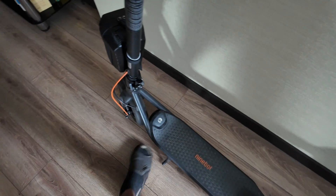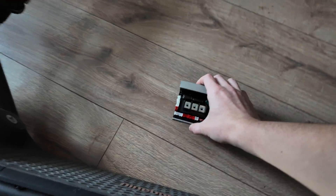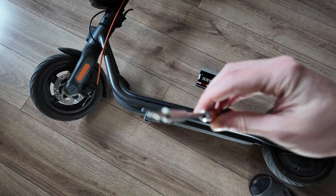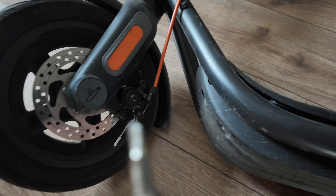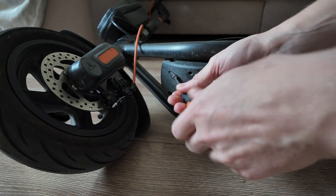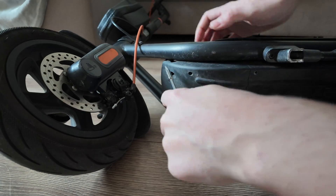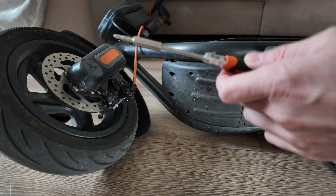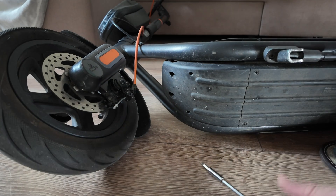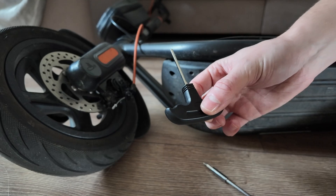Let's make it 32. First, what you need to do is disable your scooter and then put it on one side. You put it on the side, take the controller nearby. What you need to have is a screwdriver - just a regular Philip screwdriver to unscrew two screws, and a 3 millimeter Allen key. The Allen key actually comes together with the scooter, so those are the only two things you need.